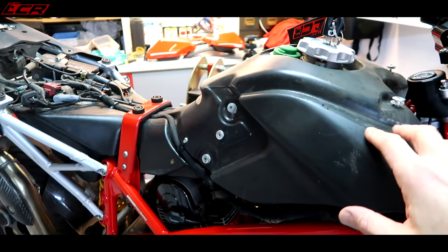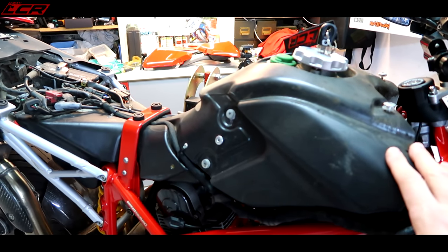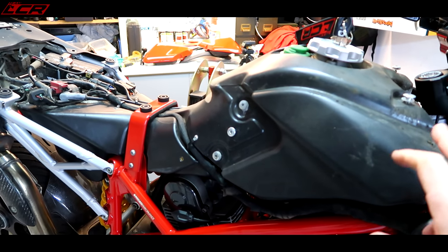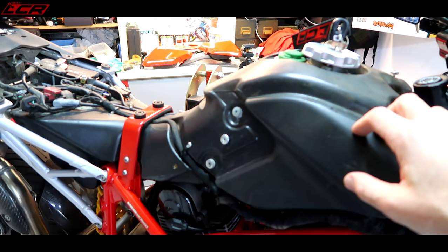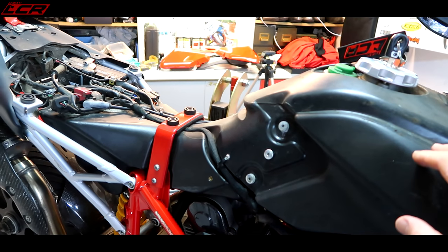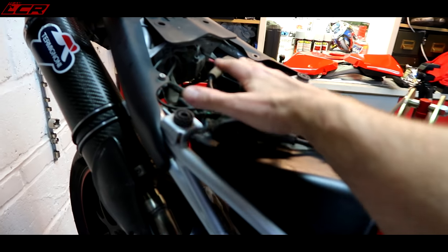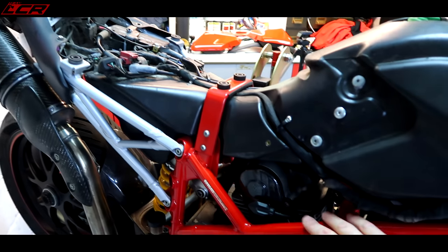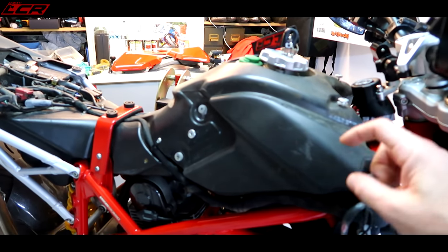Now these, I think, are only a relatively small tank, sort of 11 or 12 litres. These bikes have only got about a 100 mile range because the tank's quite small. So I know there's companies in the US, and thanks for those who sent links to them, that do a 22 litre fuel tank for one of these, which takes it up to around 200 miles range. And it still fits underneath. I think they build it up here and the battery relocates slightly, and it comes down and fills where it can. But a 22 litre tank, I can't think of the name of the company, I'll put a link below.